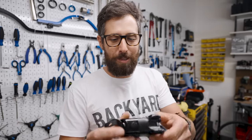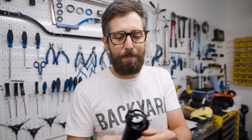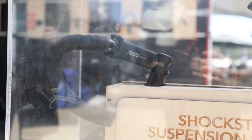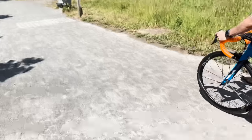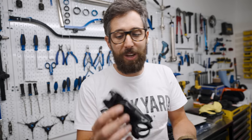Redshift suspension stem. They do two models — a pro and a standard one. I've been using the standard one for about a month and a half and it's the greatest thing ever. It's slightly heavier than a normal stem, but only a little bit. It's got elastomers inside that adjust depending on your weight, giving about 20mm of travel. So much more comfortable and more control — it works like a shock except without any bobbing. It doesn't affect your climbing, makes you descend faster, and makes you more comfortable. The less fit you are, the faster it's going to make you purely in terms of fatigue reduction. That's the future of gravel. Cane Creek does one as well with a lockout or adjustable firmness.